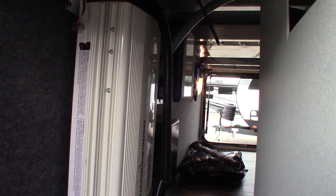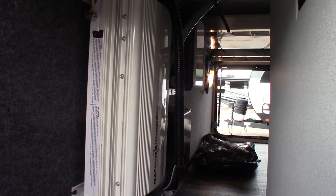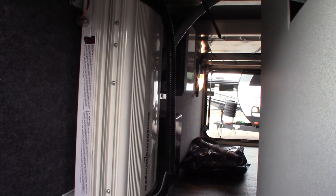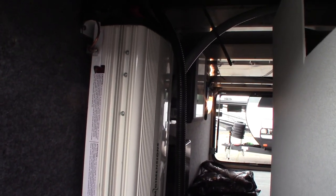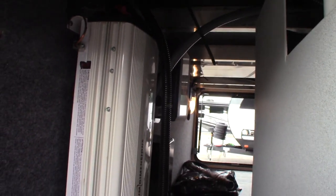Your solar panel is always putting energy into your battery. When you're towing it, the charge line on your tow vehicle will be charging the battery and keep your refrigerator going while you're pulling down the road. So it does both — it inverts power and it converts power. We'll talk more about the converter and the solar panel when we get inside.